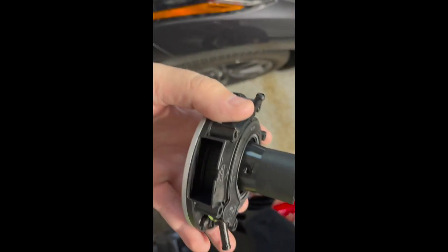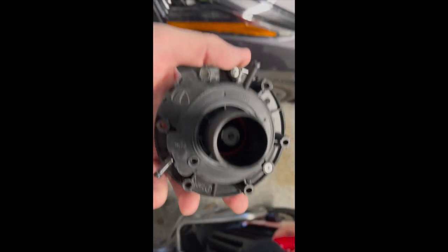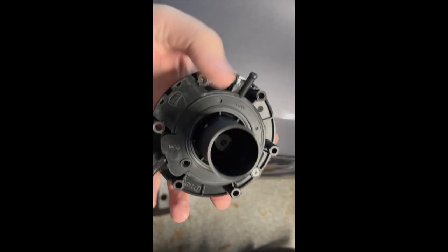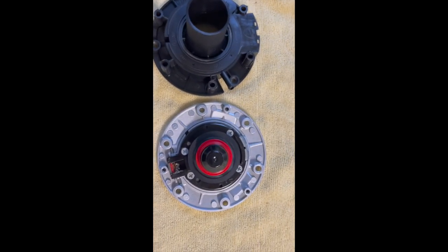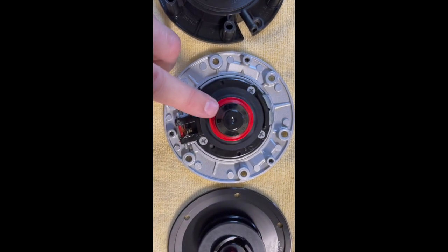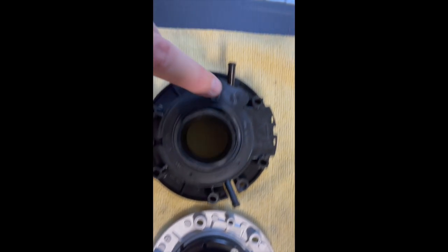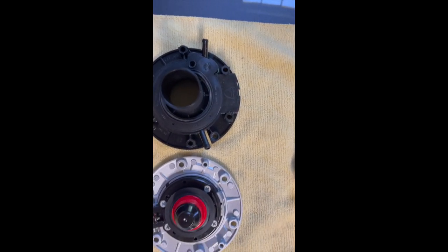Here's your gas cap. The underside has a plastic housing with two spikes on either side where the breather hoses connect. You'll need to use the Phillips head screws to remove that and retain the housing underneath when fitting the new one. With those two tiny screws removed, you can see the two components come apart. The replacement has its own rubber seal — the original was hinged to accept a key, and this will be keyless. Importantly, this rubber stays on the bike for additional sealing.